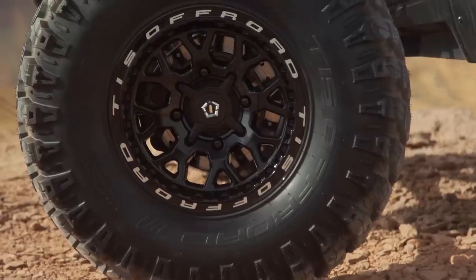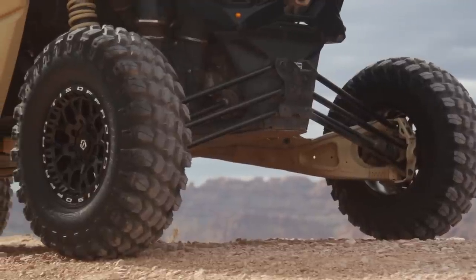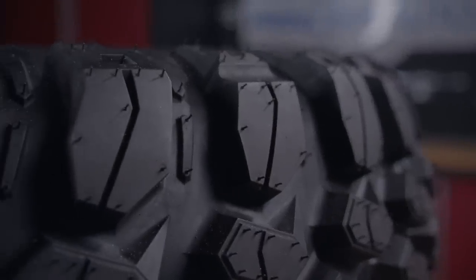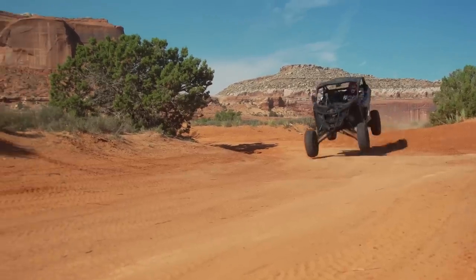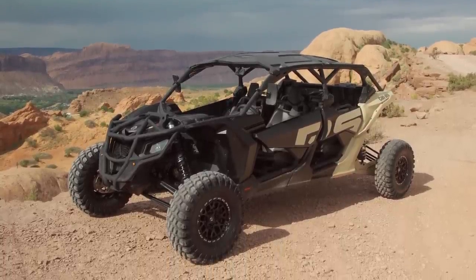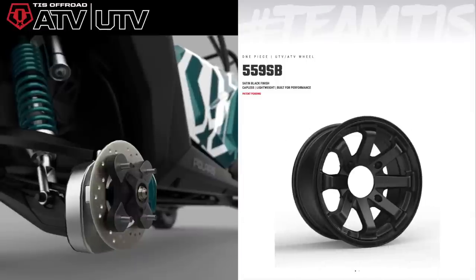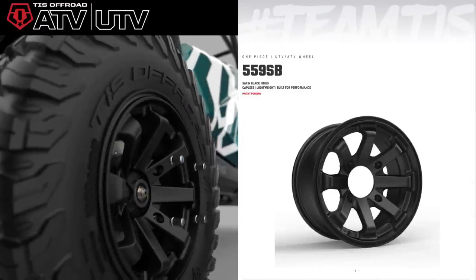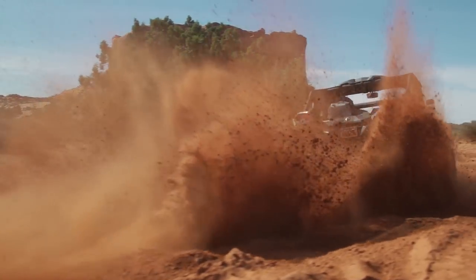The UT1 is offered in 14 and 15-inch sizes. The UT1 is an aggressive all-terrain tire that isn't terrain-specific, yet it finds a way to be capable tackling anything from sand to mud. And I know because I've tested them thoroughly. All current sizes are designed to be set up as a square kit, with 10 inches being the width of all available sizes as of our testing. This makes ordering your tires easy, but also of importance is your rotation of your tires, because we all know the rear rubber gets a bit more abuse, especially with you turbo guys.